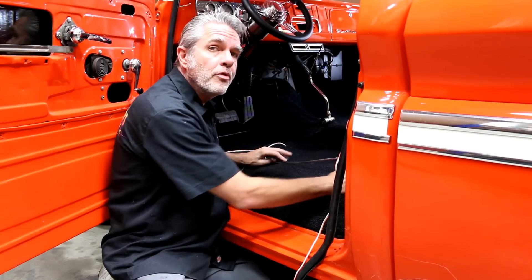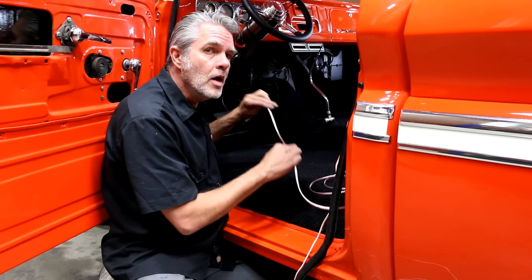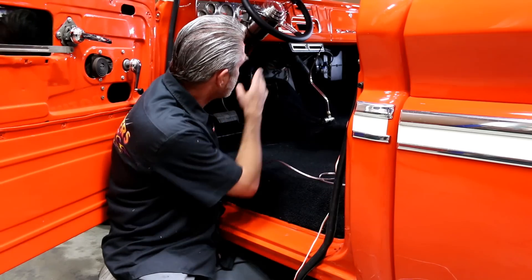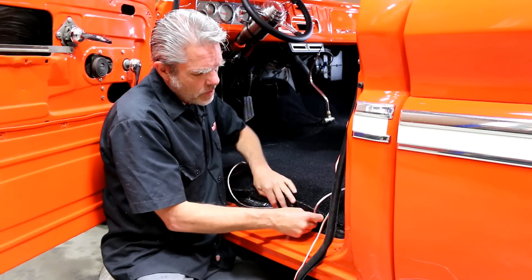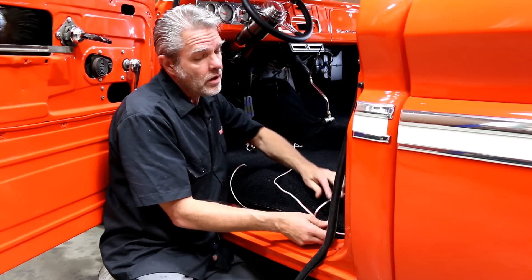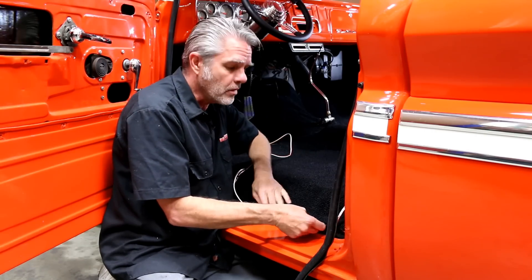Our carpet's just about done, but before we get too far we're going to take care of some extra things. We're going to get some speaker wires run — we don't even have any speakers going back here yet, but we're going to go ahead and get these up there now because it's going to be a lot easier to do now than in the future. I'll route this up underneath and up to my radio. I'm going to tuck it underneath the carpet making sure I'm away from any screws that are going to hold my sill plate down. Don't forget your dome light wire or any other wire for your gas gauge or anything like that — just make sure they are away from anything that's going to cut them.